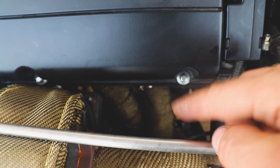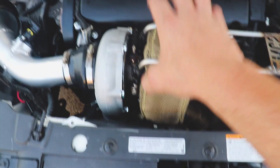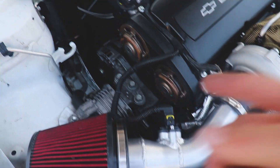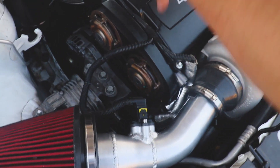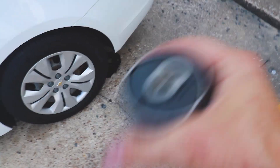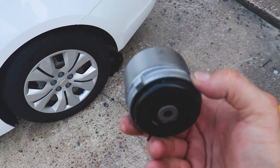We have our turbo manifold and you saw the last tutorial episode — we've got a fresh new turbo blanket on. All this stuff had to come off. I did figure out what the leak was over here in the timing area, and it was not the cam seals. It ended up being the timing belt tensioner. Here's the old tensioner. The bearings in this thing came loose and all that bearing grease was just heating up and going all over the place.